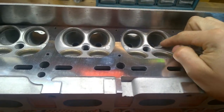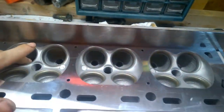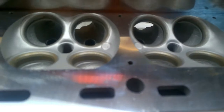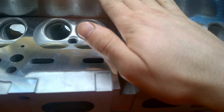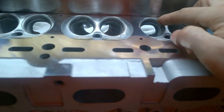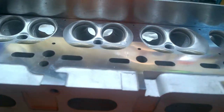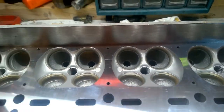Once the guides are on, I'm gonna do the valve seals, and then lap the valves — which involves this little ring right here that the valve goes on and closes. Once you do that, you pour some water over here, blow air on the other side, and see if it's sealing good. I'll show you that process too — that's a different video.